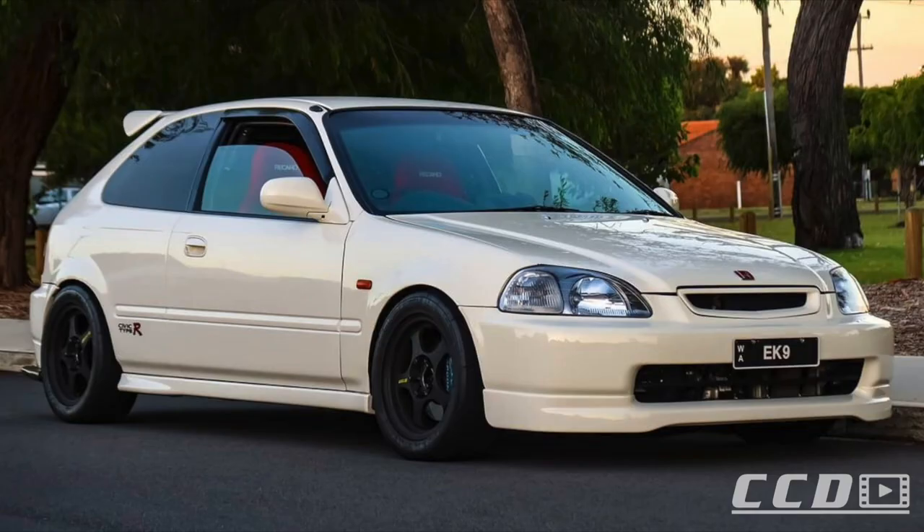This is a very temporary setup. I spoke to a guy in New Zealand — this is his car — and he told me he has 25mm spacers on his. So I knew that going with 8mm is not going to be nearly enough. But to run a thicker spacer, we're going to have to do one of two things: get extended wheel studs, or get an adapter that bolts to the hub and then has its own set of nuts coming out. If we run an adapter, the minimum thickness will be 25mm.